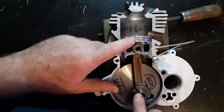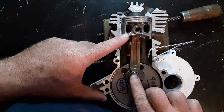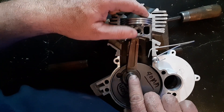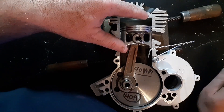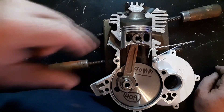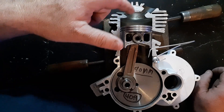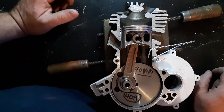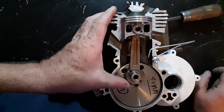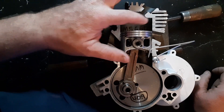This is the 56 millimeter piston. The squish value on a factory one of these is anywhere between 1.6 to 1.8 millimeters, and it's very misunderstood by a lot of people. A lot of people think it needs to be 0.6 or 0.8 in that area — that is not true for these saw builds by design. They were designed to have that gap there.